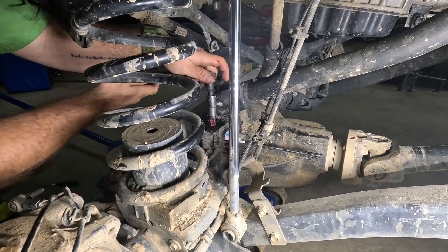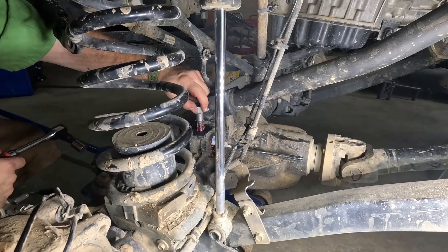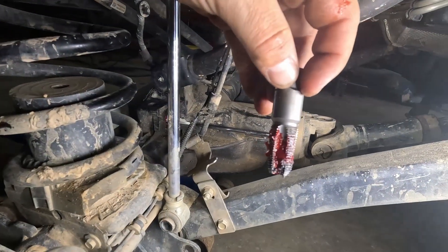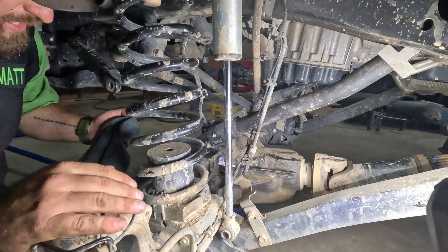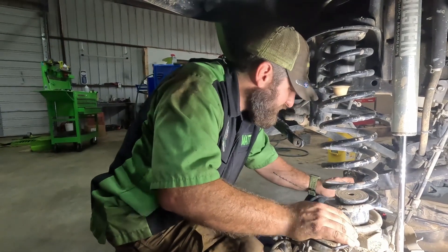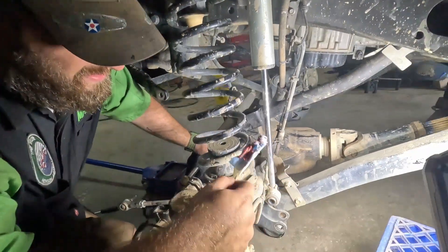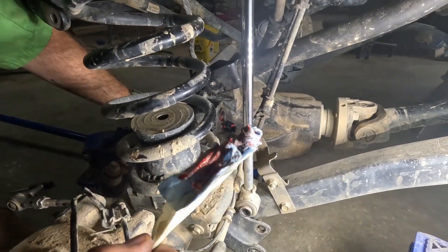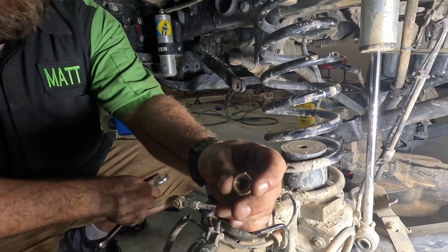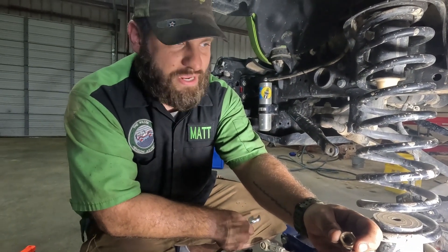You get a couple threads in it, back it up just a little bit. Some of the grease caught some metal shavings. Here's my tap — I've covered it in grease as well to help capture as many shavings as possible, because I don't want any shavings in my case if I can get away with it. We're trying not to have to change the diff fluid just yet. It's cutting — just didn't have enough downward force at first. Cleaning up is one of the most important things — you always want to make sure you get as much of the metal shavings out as you can, very carefully.